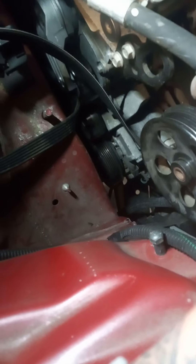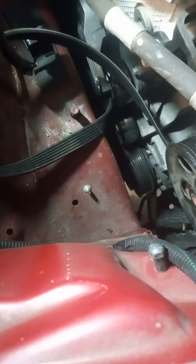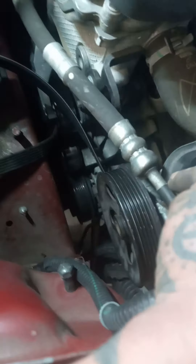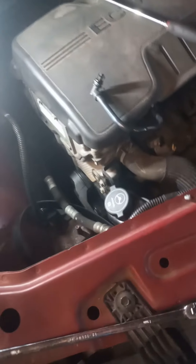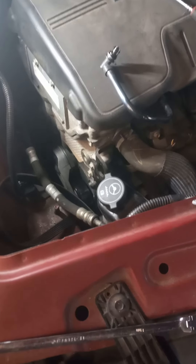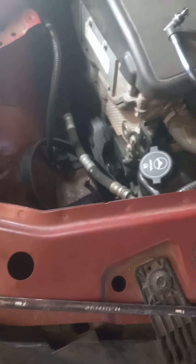Same thing to go back in — put your alternator in first, just set it down there on top of the condenser or AC compressor. Then you have to fandangle your bracket in behind this, then situate your alternator in there, put your bolts in, and then it's just bolting everything back. Not so simple, not too easy.